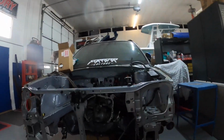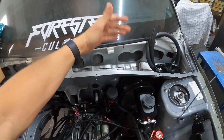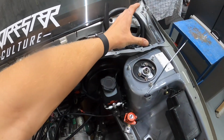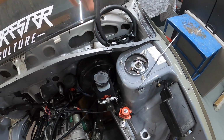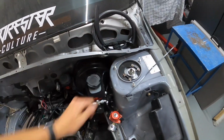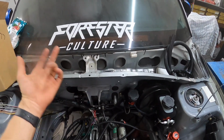So today we're gonna be talking about 3 ways that you can make your car look new again. And the first way is gonna be freshening up your trim pieces. As many of you guys know, there is a cowling that goes across here, and normally your windshield wiper motor will be behind here. So this piece basically covers this area, and any water from going down the windshield will drain into it and go out underneath the fender well. And also your windshield wipers will come through the holes in it.